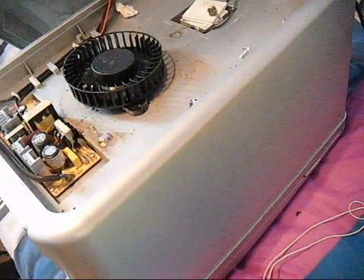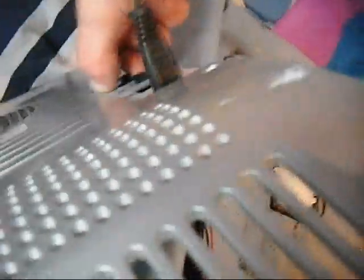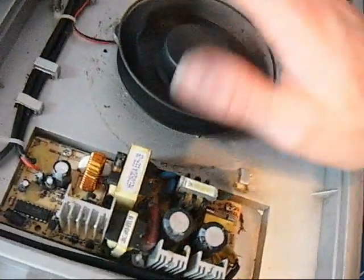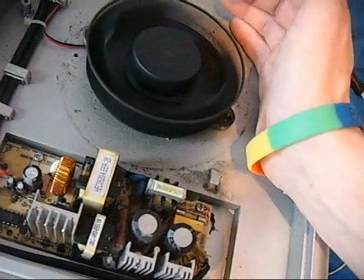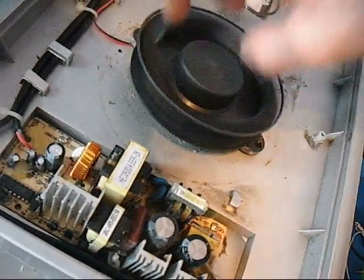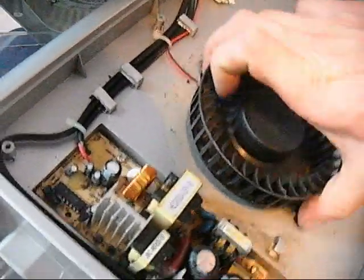Nothing's happening. Oh, the temperature sensor must have tripped it. What if I turn the heat on? Maybe the motor is a little bit shagged — not moving as much air as it could, not turning as fast as it should. That thing's hot. I'll grease it up a little bit more, have another go. It's definitely working a lot better now — spinning very freely. It could just be the fact that the motor got way too hot.